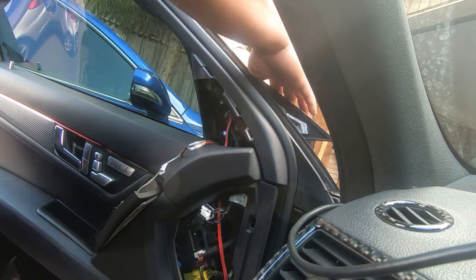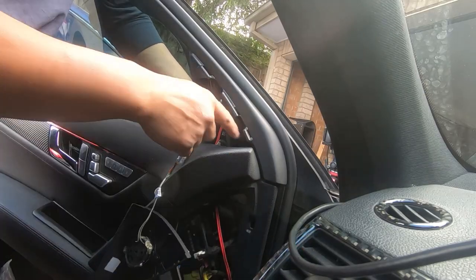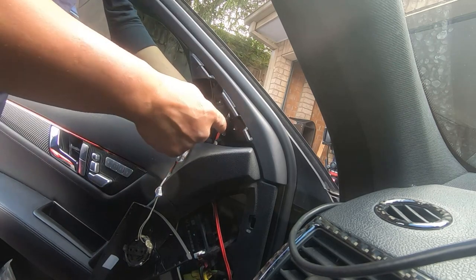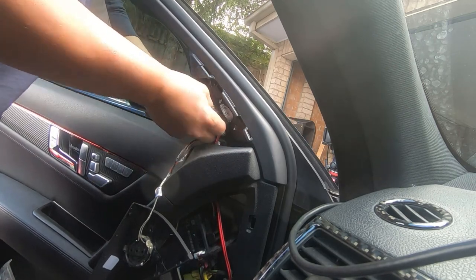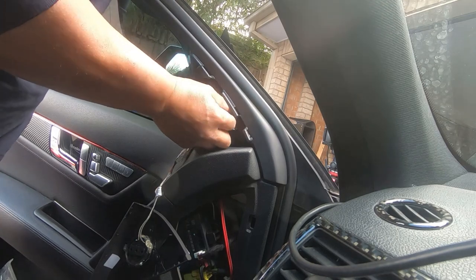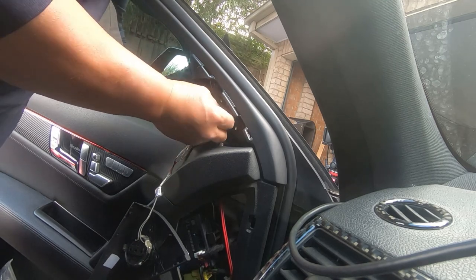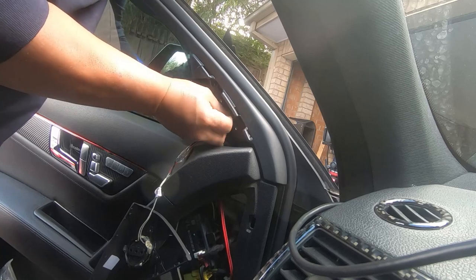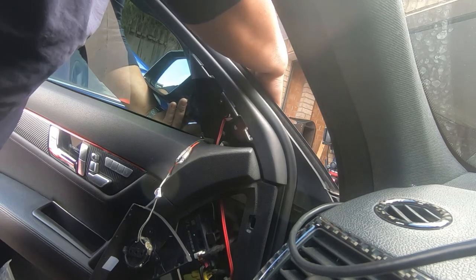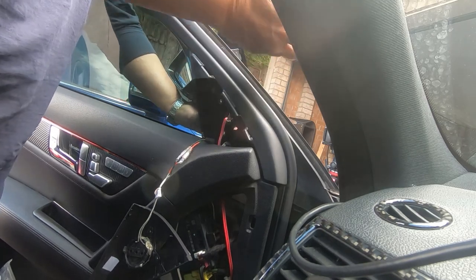That's how you remove your side mirror. As you can see, the side mirror is now removed. It's just a matter of guiding your cables all the way out through the hole in the door. Push your plugs out and feed the cable all the way out. At the moment I have my retrofit puddle light wire here, so I'm not going to remove it completely — but if I didn't have that puddle wire, this mirror would come off completely.